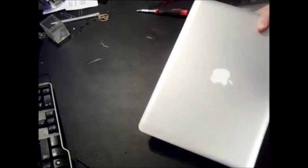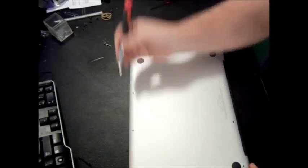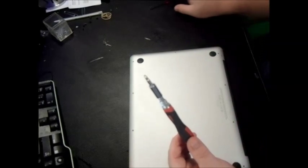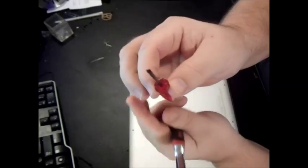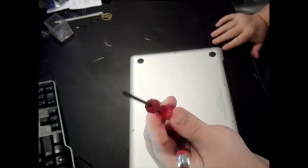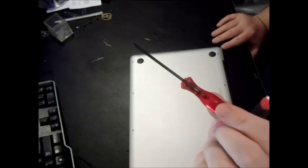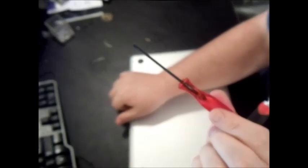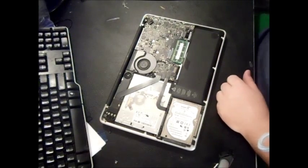What you want to do is unplug it. There are 10 screws on the corners — I went ahead and took them out for speed. The two tools you're going to need are a small Phillips head screwdriver and a tri-wing screwdriver to take the battery out. As you can see, it's got three different lines. You can get one of these on eBay for about a buck. I wouldn't recommend using a small flat head — just get the proper tri-wing. Let's go ahead and take out the battery and change it for the new one.